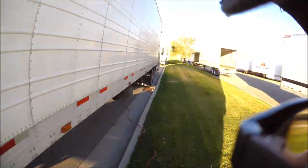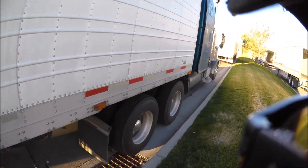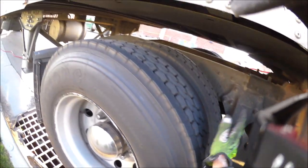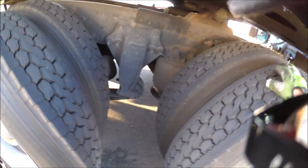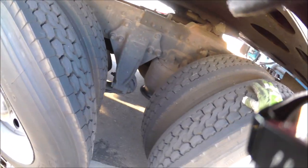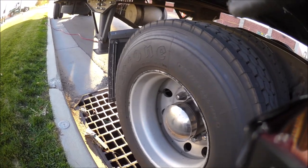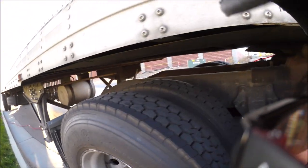I'll show you the ones on my drives. The main thing is transferring your tires - these are really nice. You can see how the meat on these drive tires is much different than the trailer tires. I need this because I'm going through mountains, snow, and Wyoming, so you really want some good stuff. I do it in the fall - many do it in the spring, and it depends on how you run. If you do it in the spring you've got new tires in the summer and they don't blow when it's so hot.